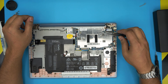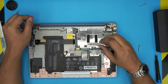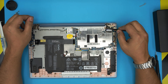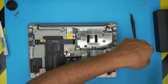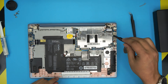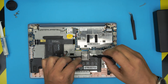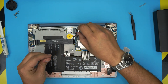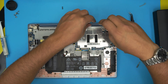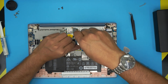After that we need to remove the heat sink. There are three screws on it, plus one under the warranty label. We're going to switch to a Phillips number one and remove the black screws first, all around, then remove the three screws in the middle. These are short screws, all the same size and height, so don't worry about mismatching them.